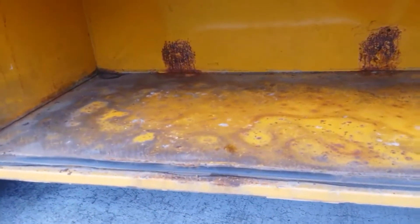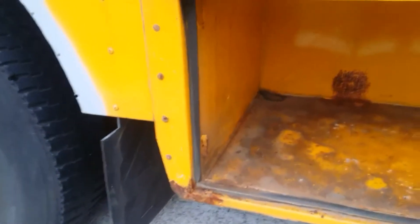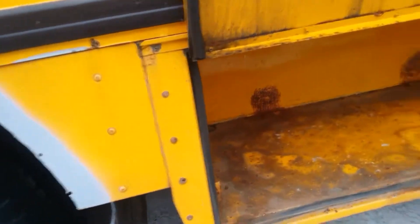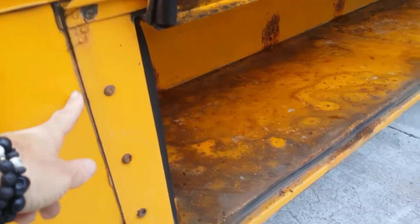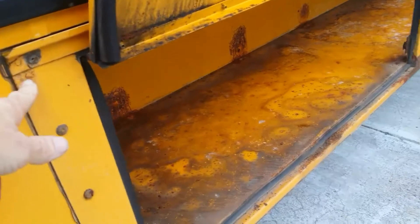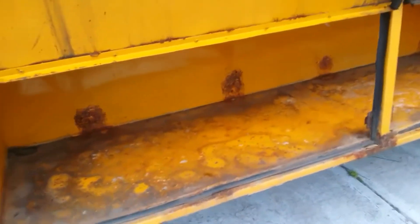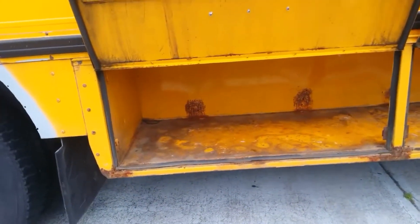I've got POR-15 so I'm going to coat the whole inside. I'm going to fix some of these latch deals - a little bent - so I'm going to straighten those up. Wire wheel, sand all that stuff off, and then my plan - it probably won't be this weekend because I've got to let the POR-15 sit a little bit - but I'm going to mask it off and POR-15 all the way out to here because of the rust right there.